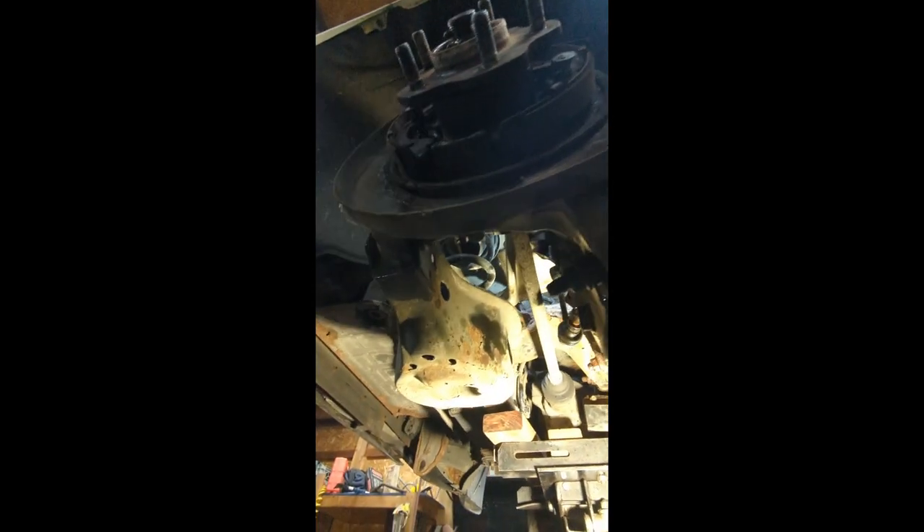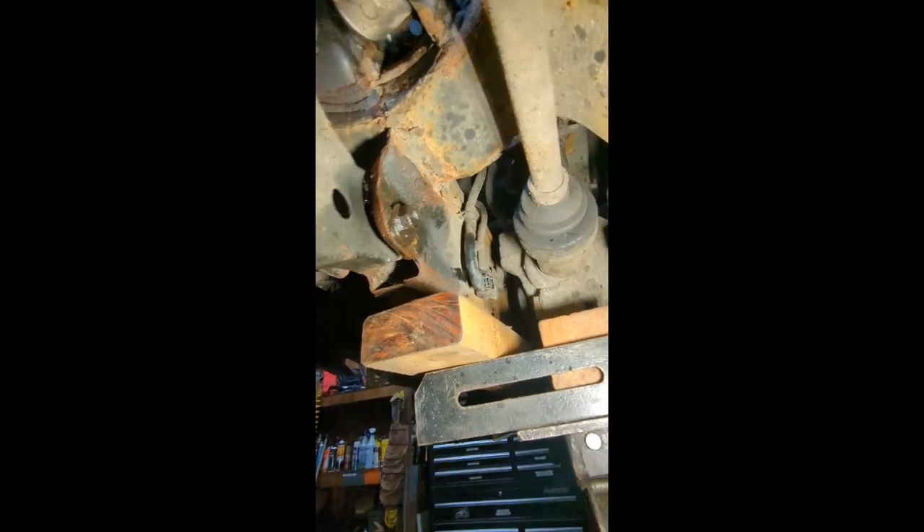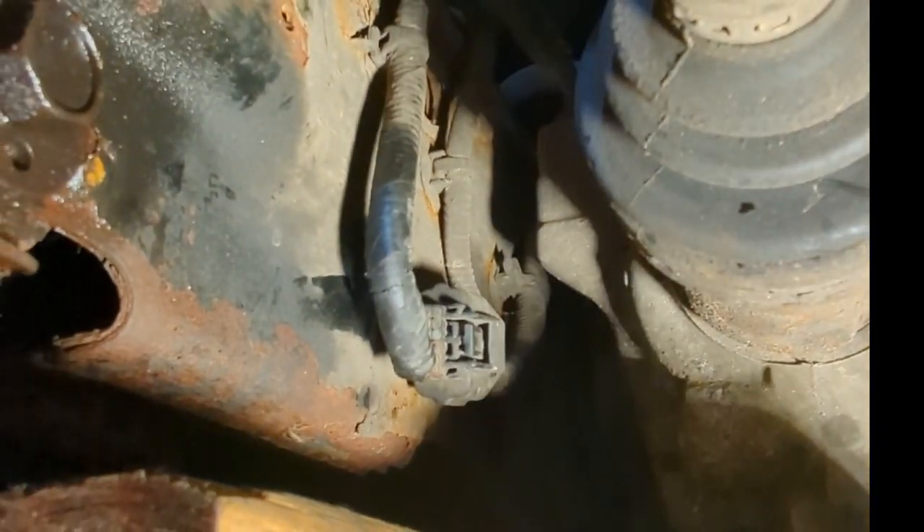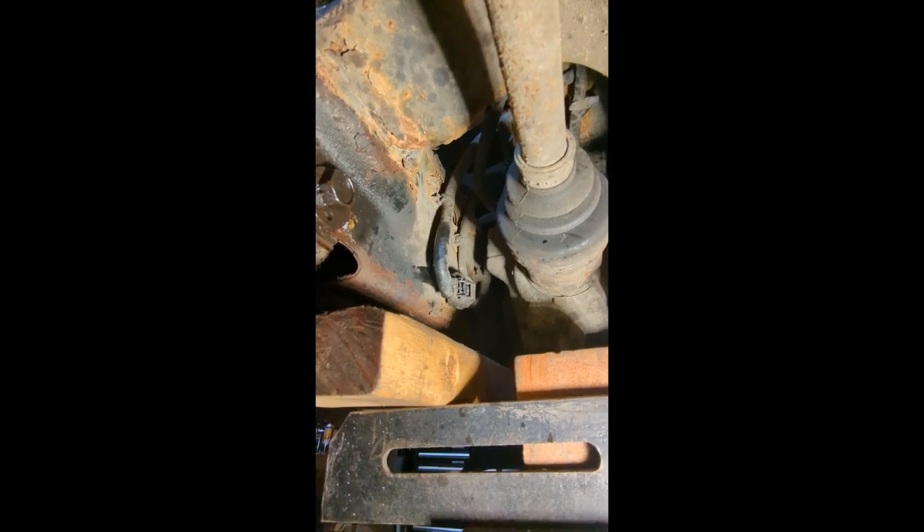Here I am underneath the vehicle — I wanted to share where that wire harness connected. That's your passenger side spring bucket. If you follow that bracket up, you can see that connector right there. You'll need to disconnect it just above that plastic clip, disconnect your wire here and pull that back out of the way. That's all for your ABS stuff.